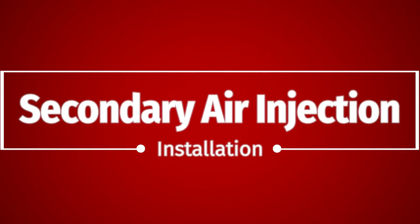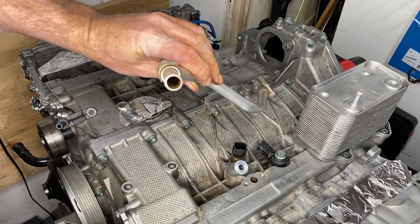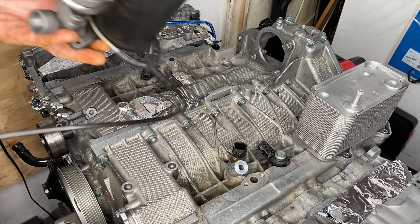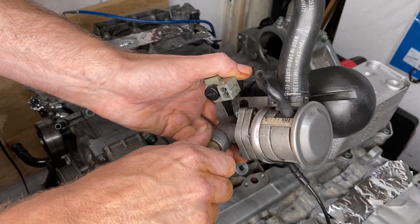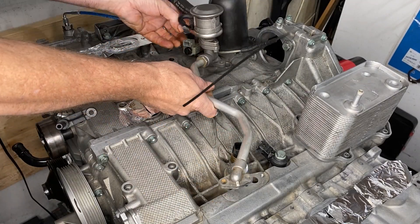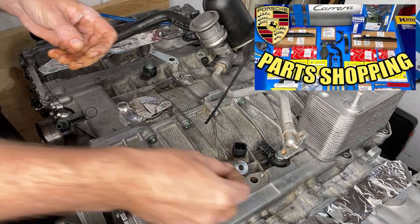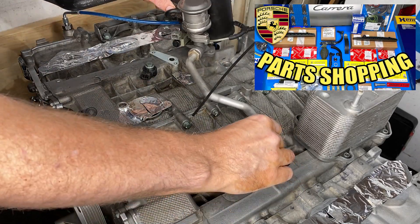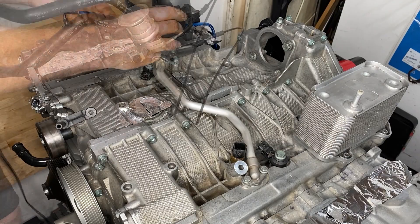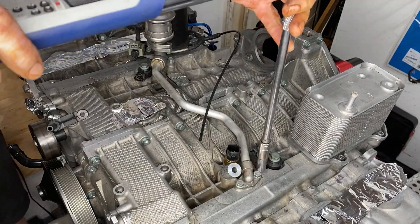The secondary air injection system: on startup, the air pipe blows pressurized smog pump air into the exhaust manifold before the catalytic converters. That additional oxygen allows for more complete combustion and lower emissions in a cold engine, which is good for squirrels and trees. The metal gaskets came in the gasket kit from episode 24. We put the 10 mil bolts in there — I don't actually know the exact torque setting for these particular bolts, so I'm going with 13 newton meters because that's very common for this style of bolt.